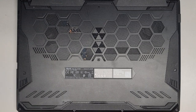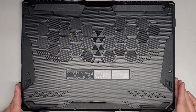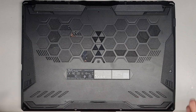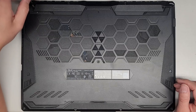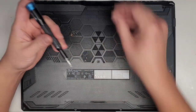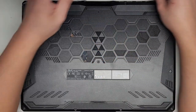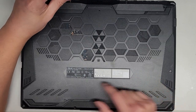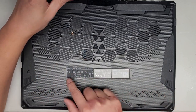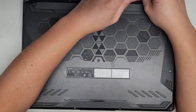We're going to be using a JIS-1 screwdriver to remove all the screws from the bottom. If you're replacing the screen, you can technically remove the screen without opening it, but to be extra safe you want to disconnect the battery first — if you don't, there's a good chance you'll fry the backlight circuit. Keep screws in order because they can be different size, shape, and length. The way I do that is I put them flat side down on my desk in the pattern I remove them. We've got four going along the hinge area, three going along the center, and four more going along down there.